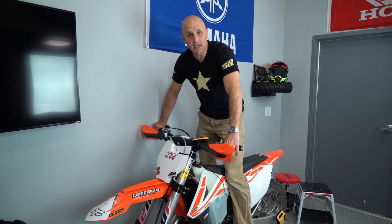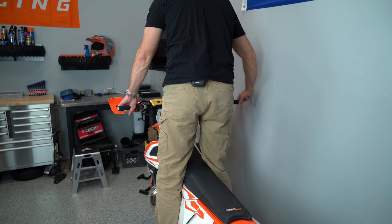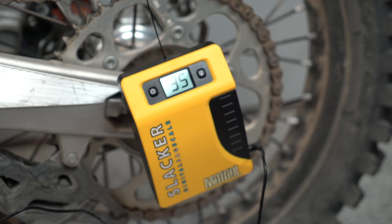On this bike, I've got it set to where I've got 105 millimeters when I'm sitting. But when I'm standing up in my attack position, I've got about 97, somewhere right in there, about 100. So I'm at 100 when I'm in an attack position, and I'm about 105 when I've sat down. It's a fine-tune adjustment, but the thing that I love about this is now I'm in complete control, and I can do my own sag without having to have people help me, and I can get an accurate, repeatable measurement. That is so awesome to have.